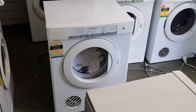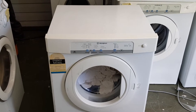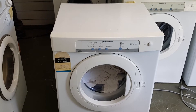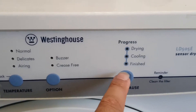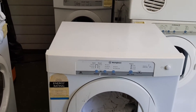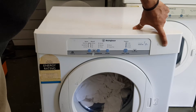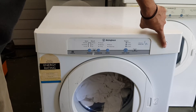But what we want to fix is this Westinghouse. This was also turning in test mode. I normally test my dryers two or three times before I sell them, and what happened is I went down — it looked like it was about to finish, it had been going for about an hour — and I came back up and it was completely dead. Normally when they finish there are some LED lights still on, and anyway, it's just dead. I came up and doing a little bit of troubleshooting, I found that I would push this button and these lights would come on, I'd take my finger off and they'd go out. Sometimes you hear a click and a lot of times you don't.